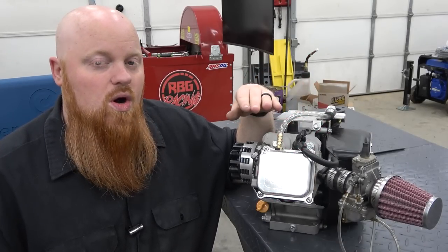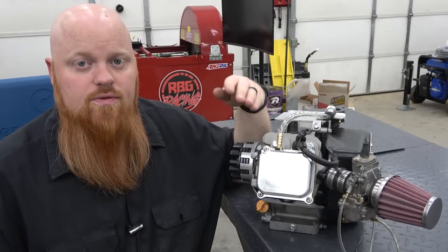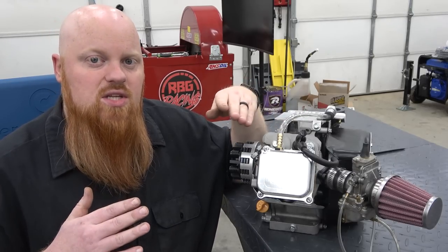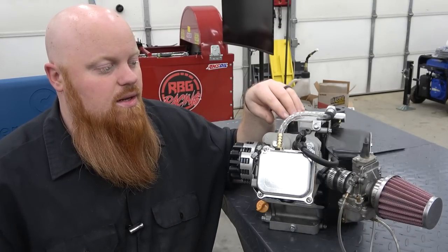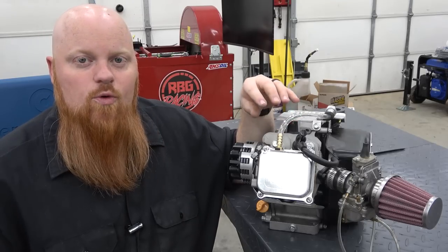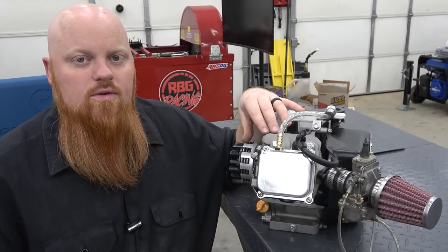And why you want the overlap is it can actually draw in the next charge of fuel and air by leaving the exhaust open just a little bit to help that vacuum effect happen in the head. Just wanted to note a few things before we throw this on the dyno. So next video we'll be porting up the head, and then we'll go on from there.